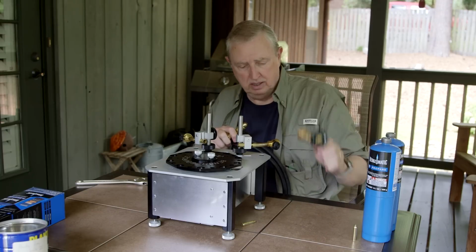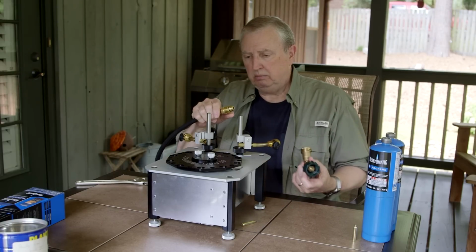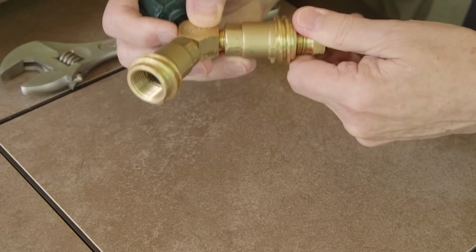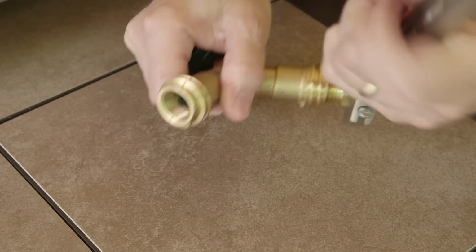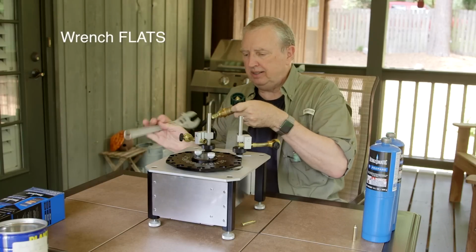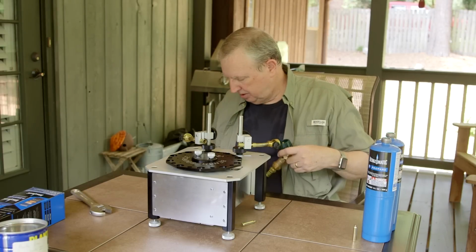They also had this. So, what's on it? Well, on one end is the fitting that will go inside the fitting on your gas tank. It doesn't look like the one that's on the hose. You could use one like that if you could find it, but this is a lot neater and simpler. It has the left-hand thread, so you screw it backwards until it gets in there. Since it's got rich threads on it, you're going to have to be a little more than hand tight with it, but you don't have to be a lot. Don't Superman that thing, because it just crushes the nose.